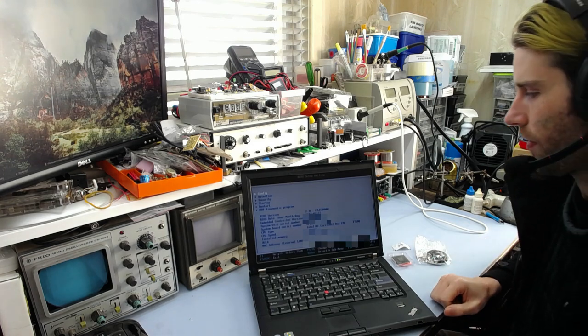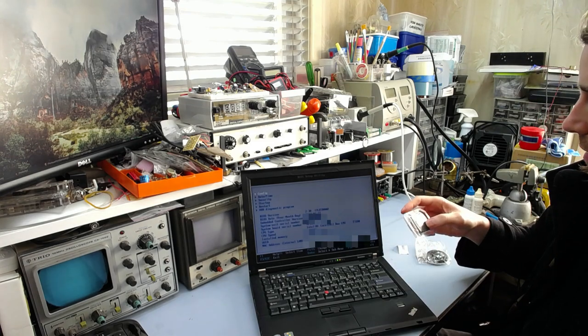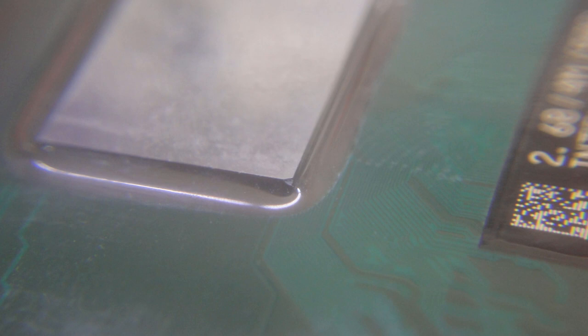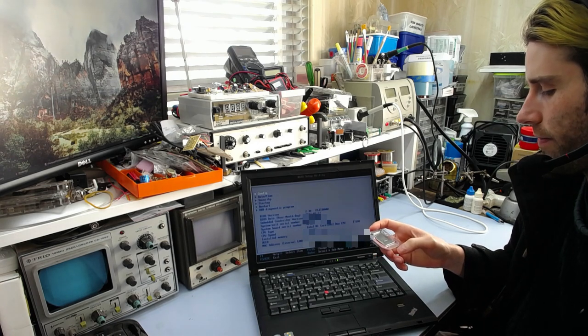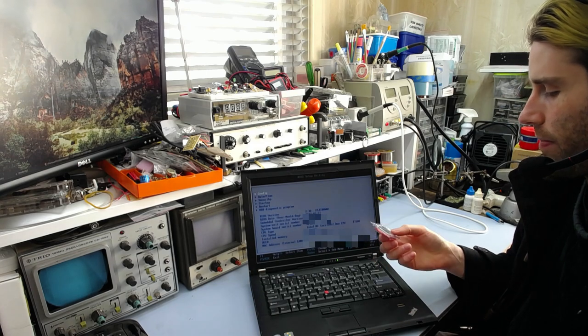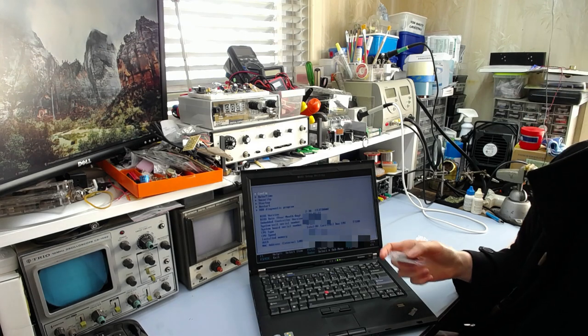I also got a new fan just in case the old one is unfixable. The CPU I bought from eBay — it's secondhand — and there is something to note: it's actually got a little chip on one of the corners of the die, which unfortunately is what happens with some of these unprotected CPUs that don't have a heat spreader on top. That's partly why they put heat spreaders on top — because people could crack the die quite easily. Hopefully the thing still works. It's a very small chip so it may not have extended into the circuitry. I'll have to test it and see if I need to get a refund. I couldn't find any locally so I might just have to get one from China.